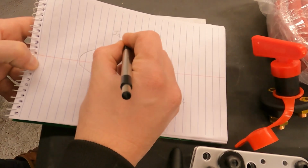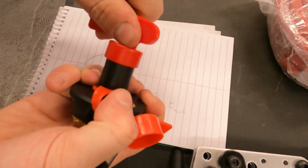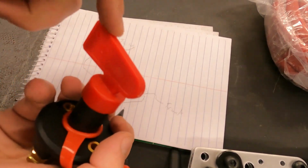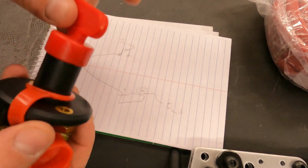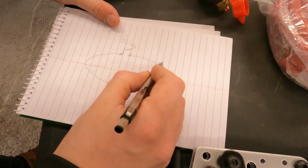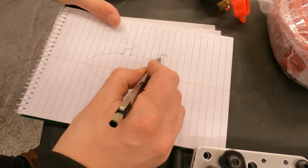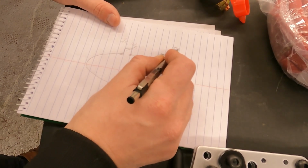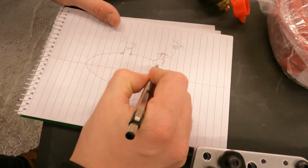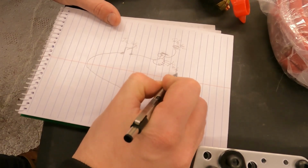I don't really remember all the drawings, but that's our isolation switch, so that no power gets to anything without the key in. This is kind of cool. It has this little plastic key that actually provides continuity when you put it in there. So this is almost equivalent to an ignition switch, since we don't really have an ignition key in our car. It'll go from the isolation switch to our little lug, which gets the power from the isolation switch, and that will also go to the starter motor. And then we also have our small little pins for anything on the relay panel that we have in the back of the car.